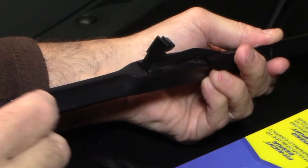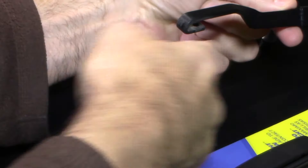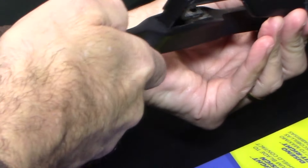There's a hook in there, so you basically unhook it, then pull it down and pull it right off. There's the hook — it's a little C-hook and the wiper sits in that channel. To install these wipers you basically go back in, push it down into the channel, push it back up, and then lock it in. These could be a little bit different depending on the vehicle, so let's take a look. The old wiper blades are getting a little dried out and the sweep isn't perfect — if you're driving in bad weather it's important to have good wipers.